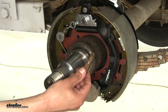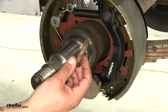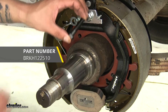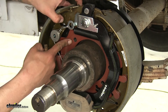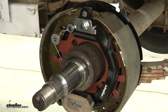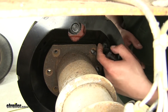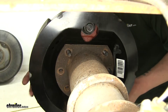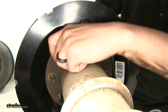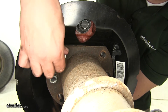Now since our hardware holding our brake assembly on is pretty worn and rusted — you can see it's covered in rust and half the threads are rolled over — it's really not going to be safe to use, so we're going to be replacing it with a new hardware kit. We can just line up the holes on the backing plate and on the axle, put our bolts in place, and then get the rest of the hardware in. One thing to keep in mind is to watch your wires and make sure they're out of the way and don't get pinched between the backing plate and the brake assembly. Just like what came off, we're going to put on a lock washer and then a hex nut to hold the bolts in place, getting them all on hand tight.